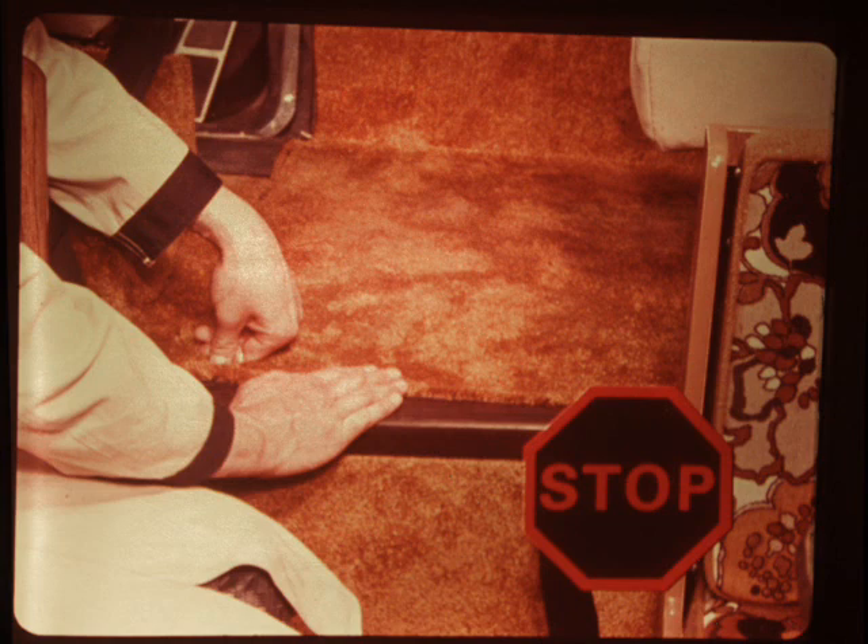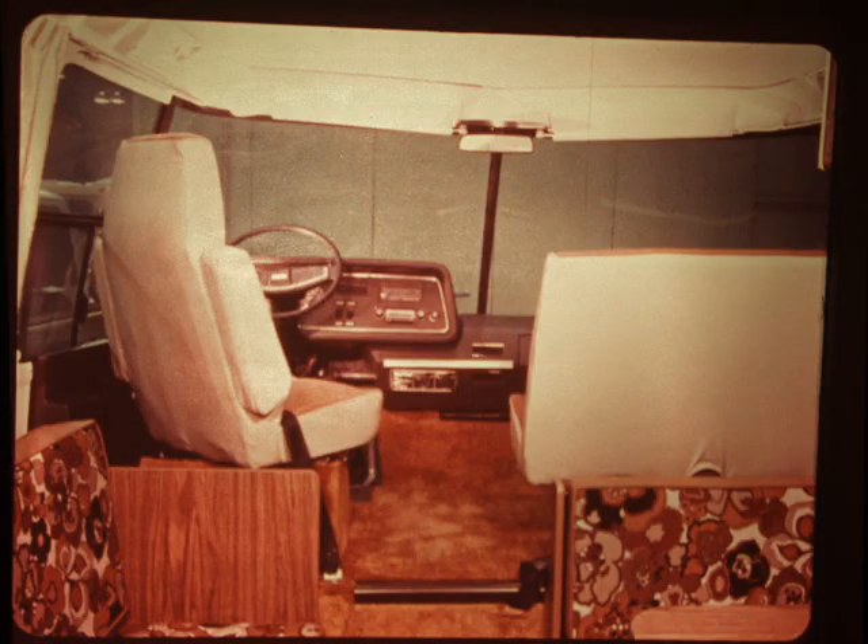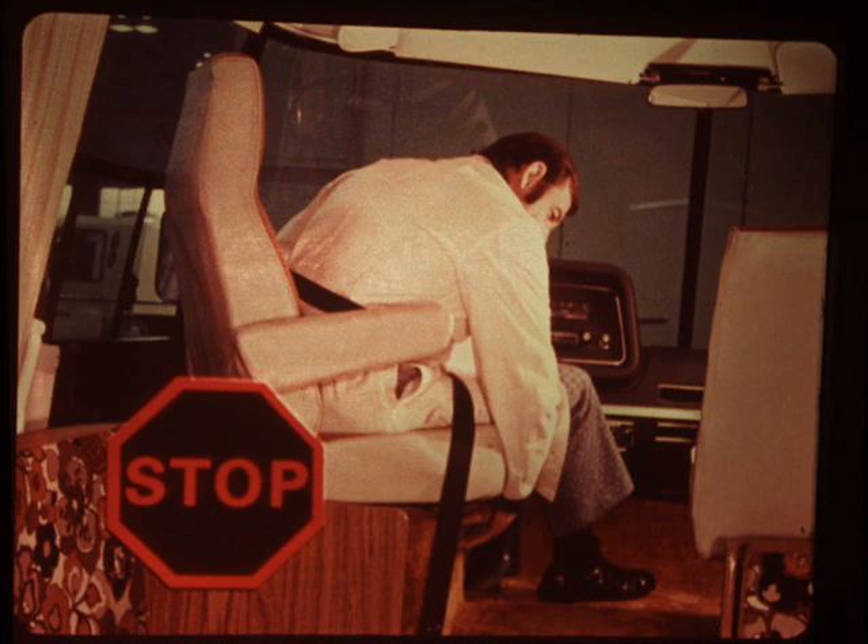When you replace the cover, it is essential that it be fully seated to its seal — make sure that the lip at the forward edge and the securing bolts are tight. Do not allow cables, carpeting, or any other material to break the seal between the cover and engine compartment. If the engine cover is not correctly installed and seated, engine exhaust could leak into the passenger compartment creating a safety hazard. The driver and single passenger seats can be adjusted forward or backward by releasing the seat locking lever on the left side of the seat and exerting slight body pressure in the direction you want to move. These seats also swivel — release the locking mechanism by moving the seat swivel lever and turning the seat. The dual passenger seat on the 26-foot model does not swivel. Make sure that all swiveling seats are locked in the forward position before the vehicle is driven.